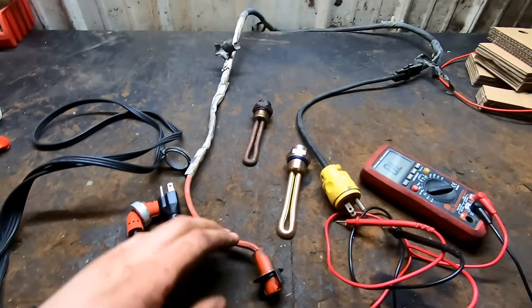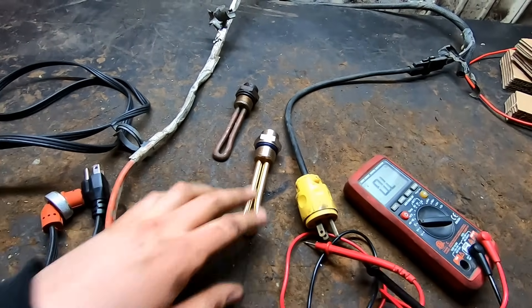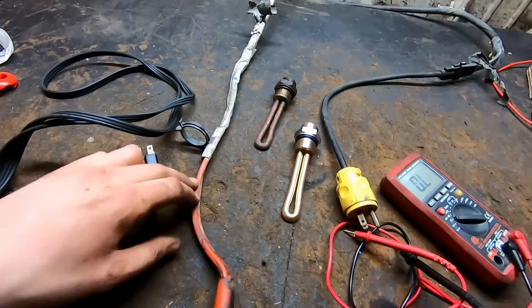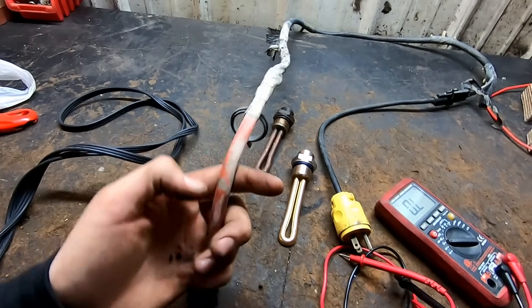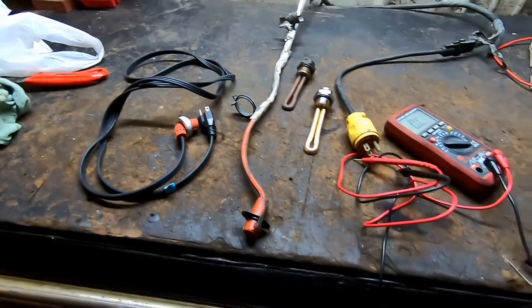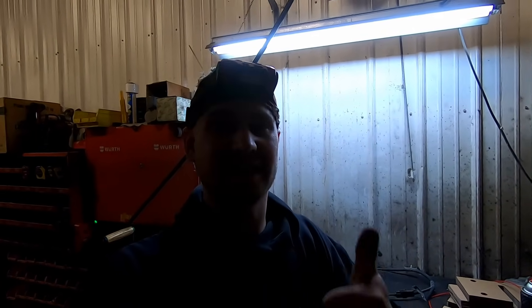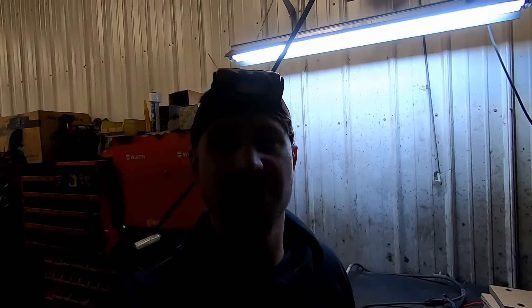Normally I find it's a break in the wire, but unfortunately this one actually needed a new block heater. If you do find a break in the wire, try to use solder and heat shrink when you fix it. Do not just strip the wires, twist them together, and tape them - I've seen that before and you're probably going to burn your truck down. Make sure you're using proper connectors and heat shrinking it so water and corrosion can't get in there. That's it for the video - if you enjoyed it or found it useful please like and subscribe. Questions in the comments or shoot me a message on Instagram at Dark Iron Diesel. Thanks for watching and we'll see you on the next video.